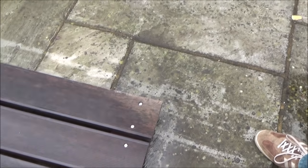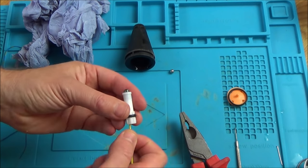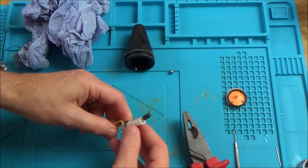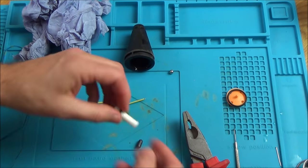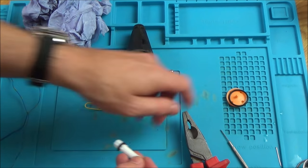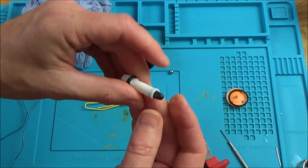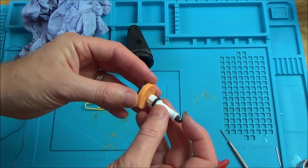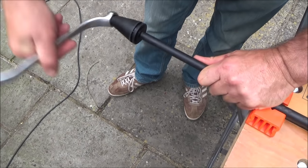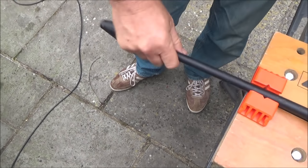Let's take the nozzle out by a millimeter just to see if that works, and if not, see if there are any spares. This may damage the nozzle but we have a paper clip. I'm going to go straight down into the nozzle - there it goes. Let's pull it out completely. Looking at it again, there's no scale in that whatsoever. Why don't we leave it long so it pushes everything together - just in case it was dropped and whacked in. That's about two millimeters longer than it was. Just in case it's not making the proper seat at the bottom. We're going to tighten this up with the spanner now.